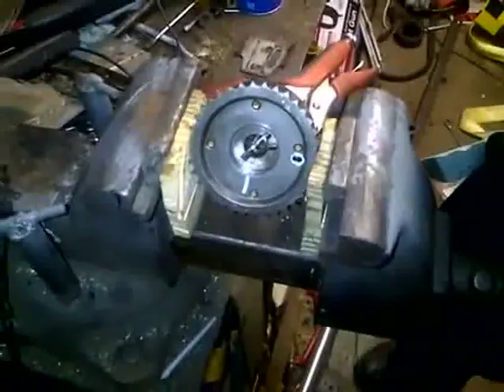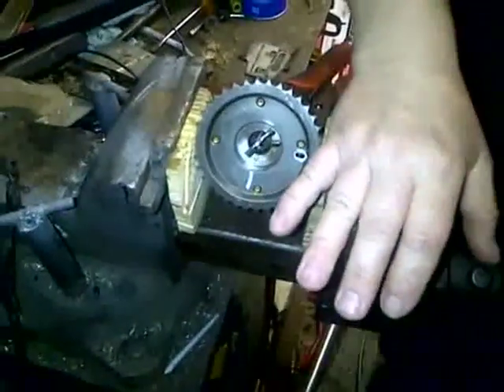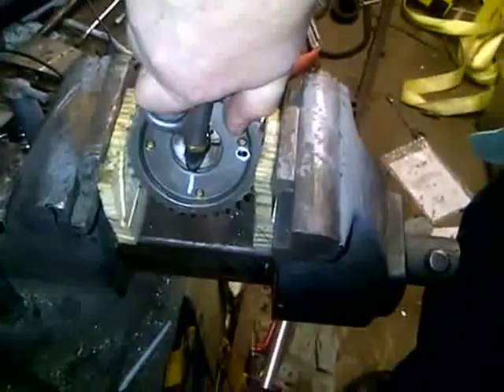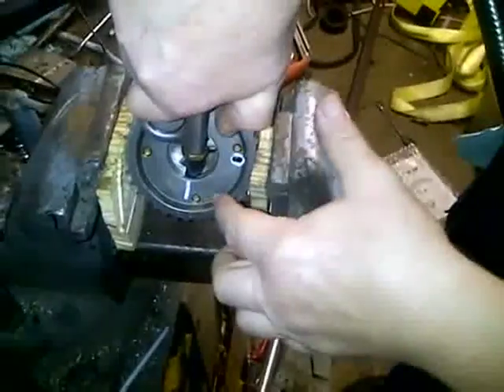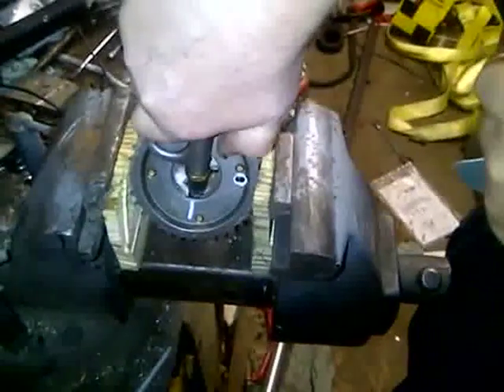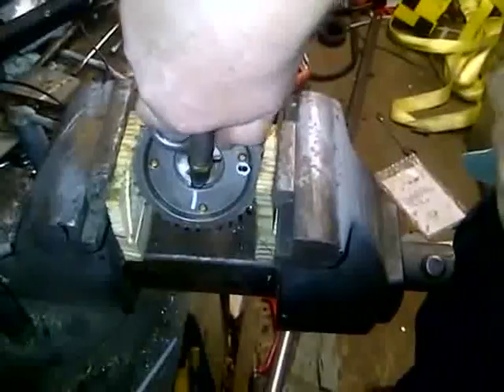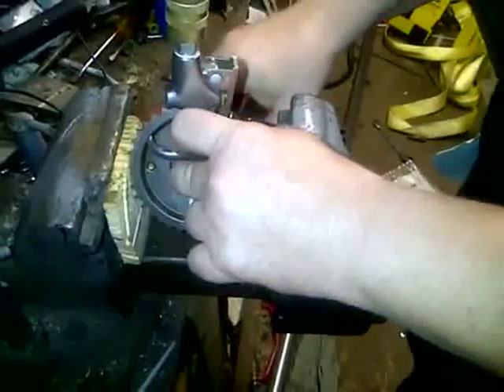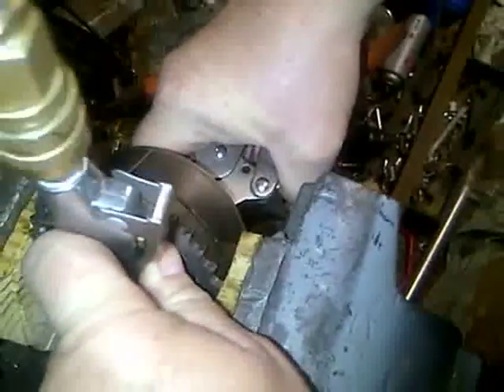This is what I use to pressurize it: an air nozzle with a little rubber tip and a small hole in it. You're going to put that inside the hole, because that hole is small. When you get it right, you're going to pressurize it and you're going to feel this thing click. There's a locking mechanism inside that's why you're using that air pressure to unlock it. This unlocks that locking thing and you hit it and you'll feel it go click, click. Then you'll be able to turn it — it has to go counterclockwise, so you're going to turn the back clockwise. You turn it and then you let off the air pressure and it'll be locked.